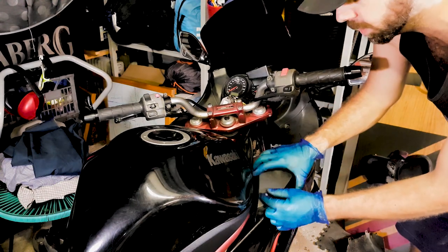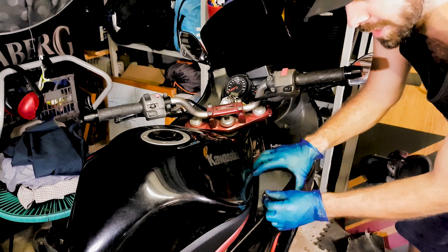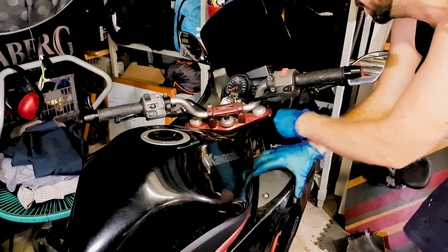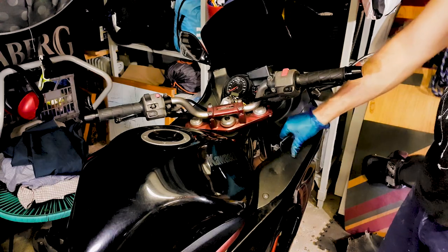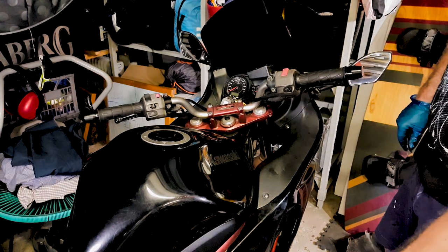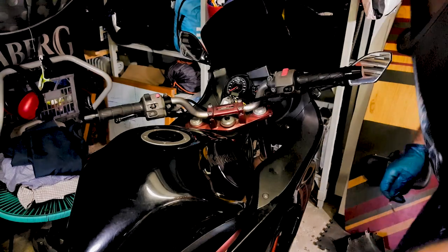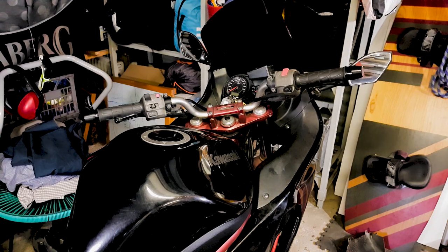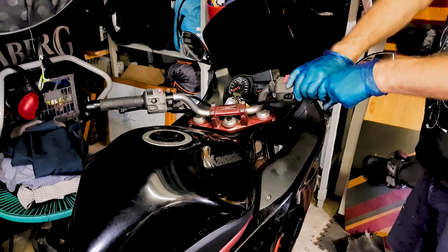Remember, when you're checking the coolant level on these particular bikes, you want the bike level as it is now. Like on a paddock stand, it's a good way to do it. Okay, so we've got this cover back on, that's all in place. We've replaced the coolant. We've double checked all of our bolts. Only thing we've got left to do now is put new oil in and then run the bike for a test in the workshop. And then if I'm happy with how she's looking after that, we'll take her for a run.